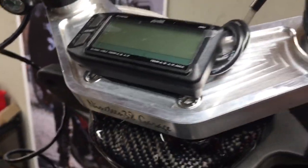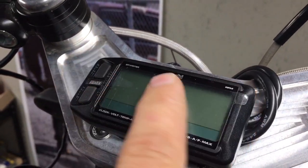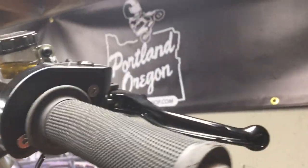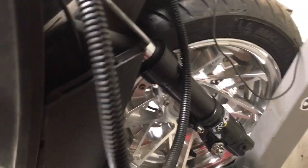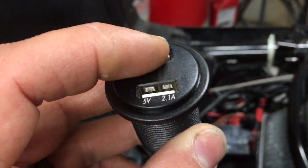The mechanical cooling pump is built into the motor, so no electric pump needed. The only electrical on this bike will be the taillight, headlight, charging port with LED voltage readout, and the gauge. This is a Polini gauge in a 1938 Garage billet mount with a moss carbon bezel — it shows cylinder head temps on left and right, so dual temps, plus tach and voltage. I can program alarms and whatnot. I've also got a Voca twist throttle — really like it, snaps back nice, quality billet — and Magura levers. I need to bench bleed one still.